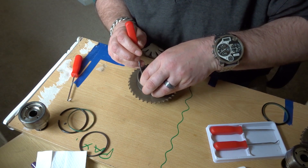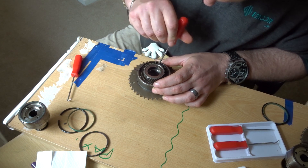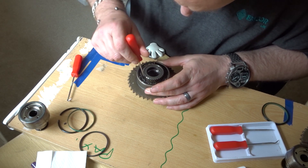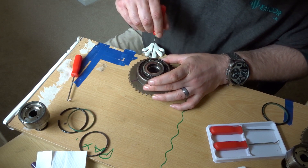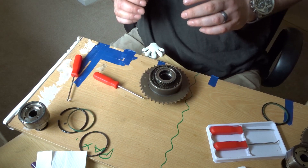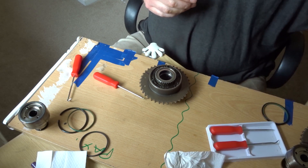We're starting to get to the end of the O-ring now — it's just a matter of popping that end in. Now it's all seated under there. It's a matter of going round and just making sure that the O-ring is seated correctly into the cavity. Technically when it's in there, you shouldn't be able to see the O-ring — it should sit quite nicely under that plastic housing. Just lifting the center piston back up again, making sure that's all in there properly.